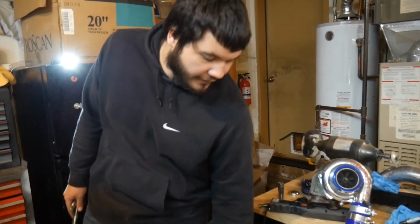And we got a brake booster and a reservoir for the Ford. We bled the brakes and adjusted the stuff on there, and now the brakes work really well. We did have an instance where the booster was over boosting, just applying pressure on the brake, and as we were driving it was creating a lot of heat and was smoking and smelling really bad, so that was pretty fun. It didn't smoke very long, and luckily it was like 30 degrees at the time. It was at night, so we got it home pretty quick, and no damage was done. As far as we could tell, the brakes still work. Now they bite really good. They bite harder than the 4Runner, and the 4Runner's brakes work really well, so happy about that.